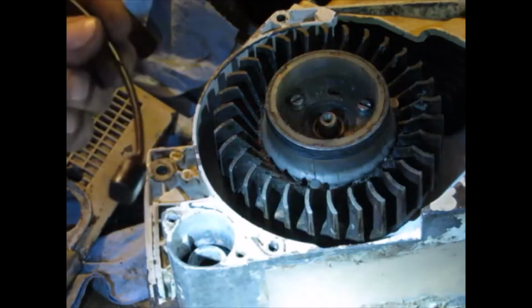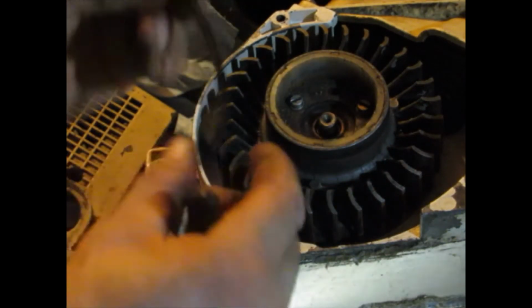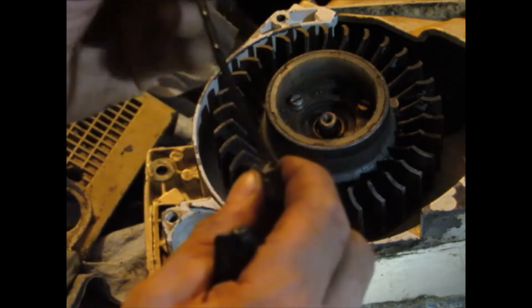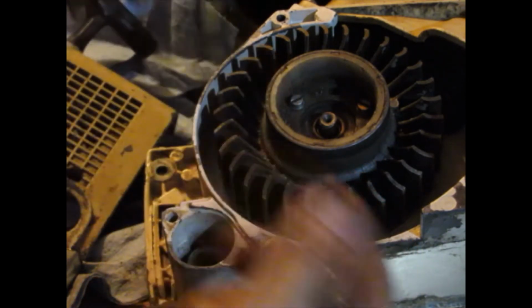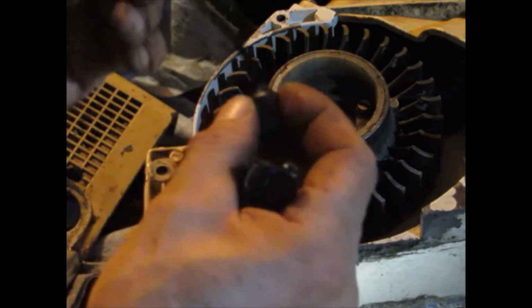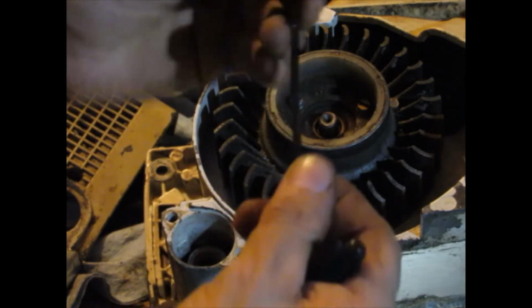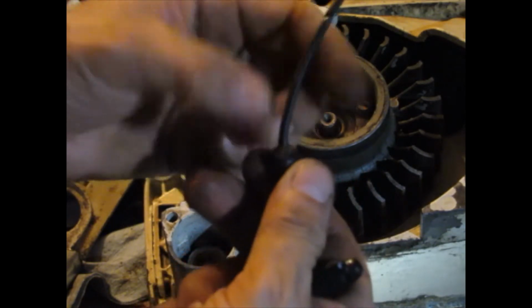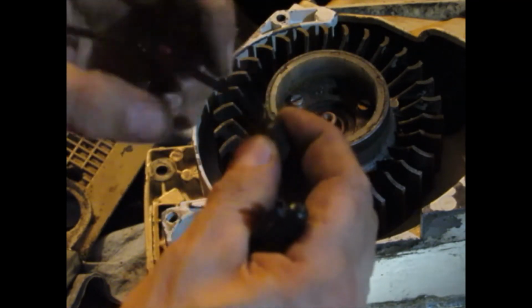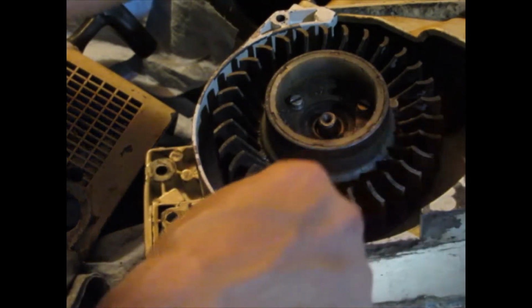This is my piston stop. I used a plastic one. This did have a hard plastic that was kind of shaped, kind of like that, and they break the first time you use them. So I drilled a hole in the end, and this is trimmer string that I used some plastic weld type or plastic epoxy type glue and glued that in. That's been working really good.